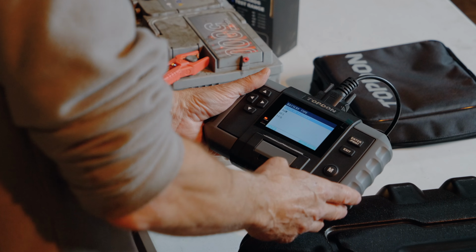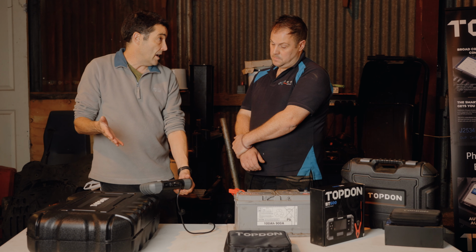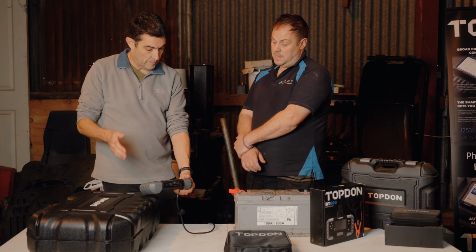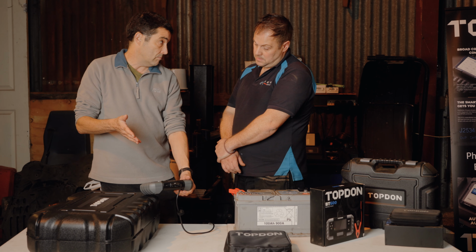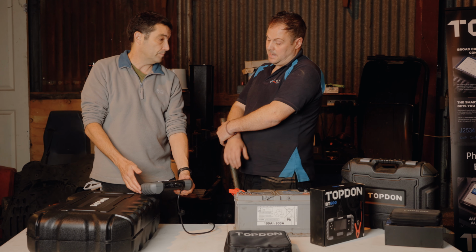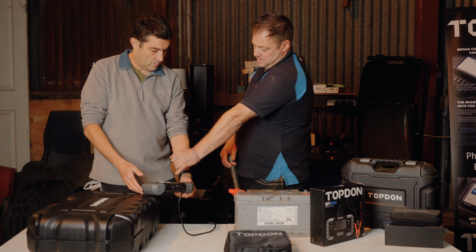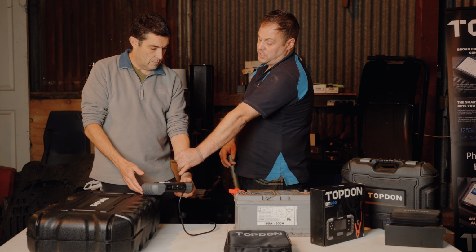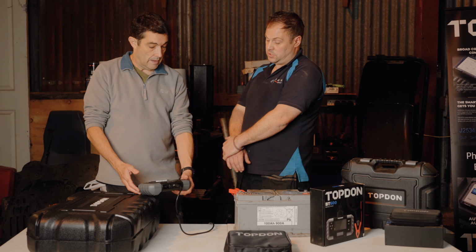And the type of battery is it. Now I've got a few options here: regular flooded, AGM, that's the sort of battery for stop-start systems. It is, yeah. A lot of the modern cars. Gel batteries, I guess are the sealed ones, mainly inside the car, if they're in the cabin. Yeah. Your EFB, it's a version of the AGM, not exactly the same. Yeah. Generally fitted to the lower end, smaller cars with stop-start.